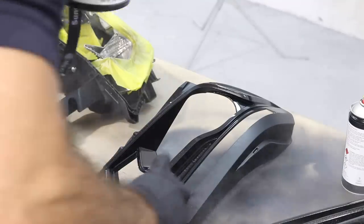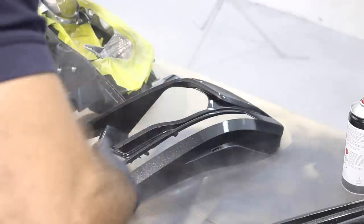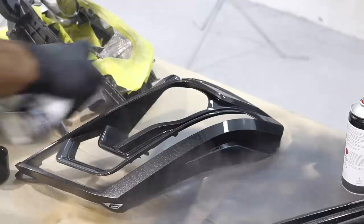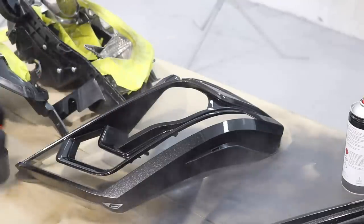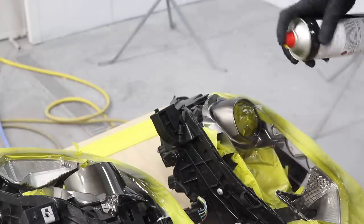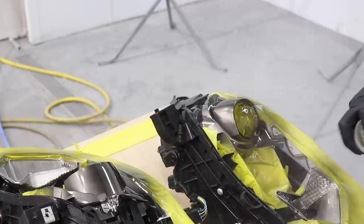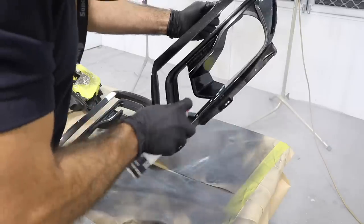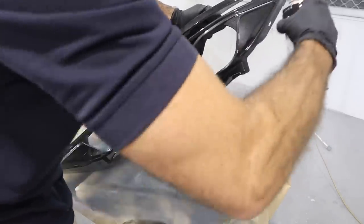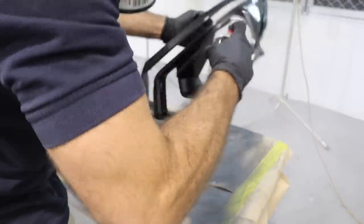Now it's time for clear coat. Now you can use a 1K acrylic clear. I like to use 2K clear, so I've got 2K clear coat in this can. Basically 2K means there's two parts. So most of those cans that are 2K have an activator where you activate the can and it allows you to spray a two-pack clear. I've got a video on that, so check it out. I'll put the link in the description. But the 1K clear is pretty good as well. So I've sprayed two coats of clear over these parts. Now I'm going to let them dry overnight, then I can start assembling the light back together.